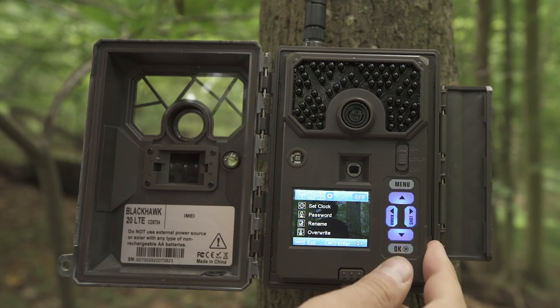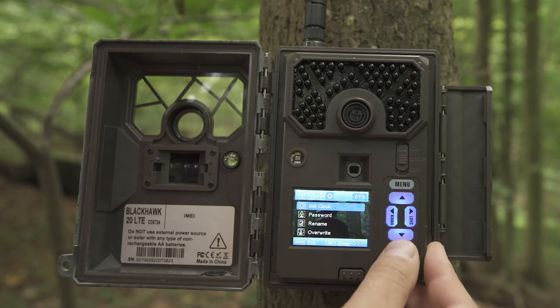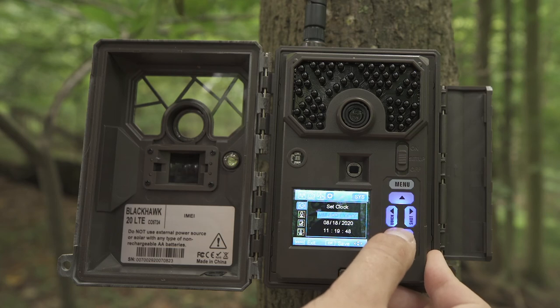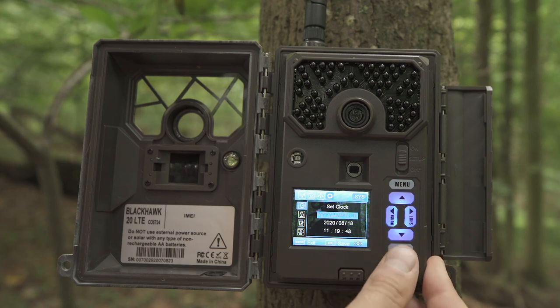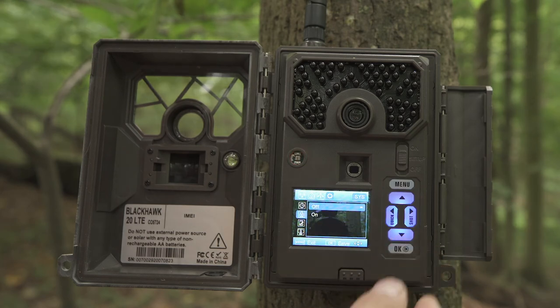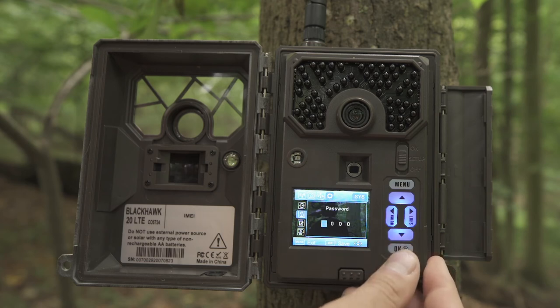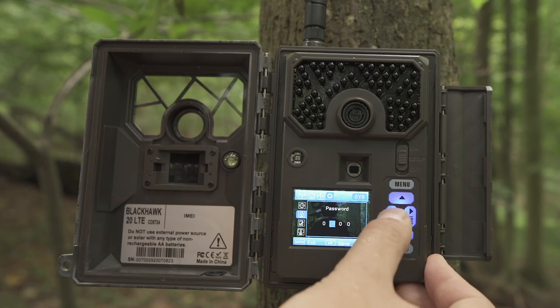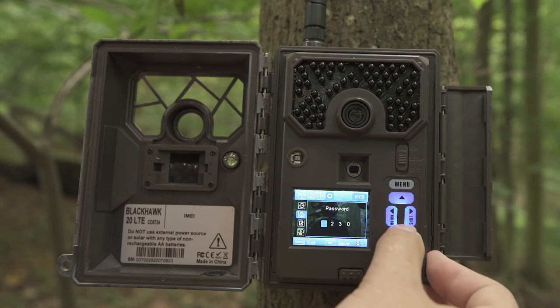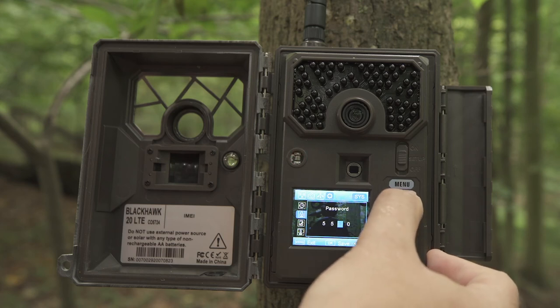Once you've chosen your trigger mode, scroll up to the top and hit Right to adjust your System Settings. To set the clock, scroll down and hit Enter. Please note the clock is set automatically from the wireless network. Using the down arrow you can choose different date display formats. Once you're satisfied, hit OK to save — please note the clock will be in military time format. For password, select On and enter a four-digit code to protect the camera from unauthorized use. Be sure to note the password and store the code in a safe place, as it will not be possible to reset the code on your own.